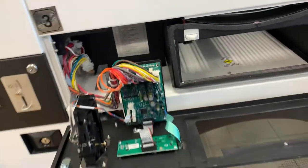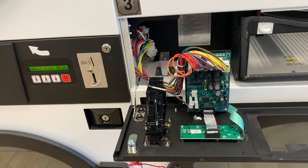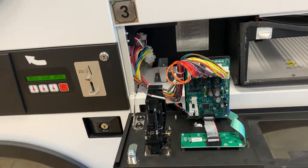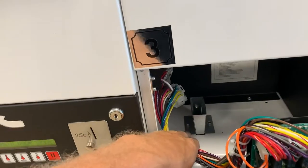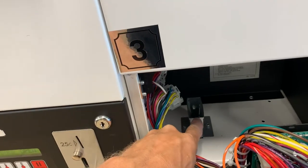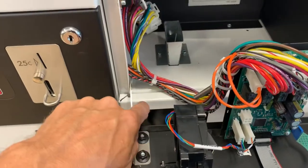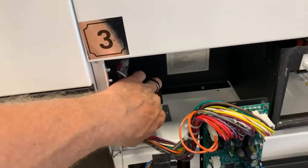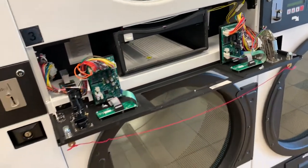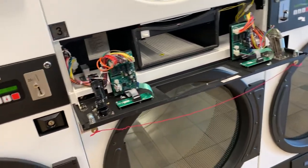And then that's it — pretty easy installation. If you watch the other video I did for the ADC 333s and 444s, they're a little different: they're not expanded like that. You actually have to pull the coin vault out down here, cut the hole bigger, and then put it back in. But these ones are actually turning out to be easier — just get a little bend and you're back in. These can be switched over, probably start to finish, maybe five to ten minutes. They're very simple.